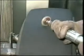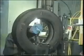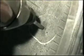Large damages or through holes are filled, covered and reinforced with Moderni tire patches GNR and GBT. However, small damages or through holes produced by a nail, etc., are almost all easily repaired with GUT patches only. Check the damage first and mark with chalk. The damage is smoothed and buffed out with a carbide cutter